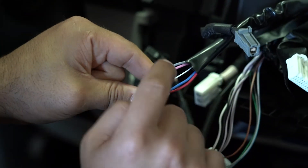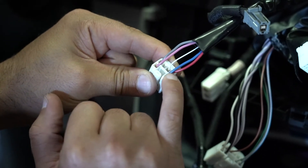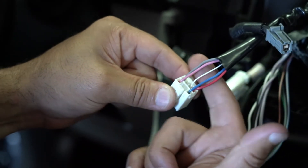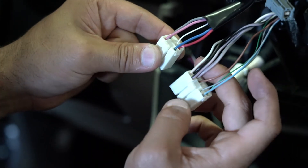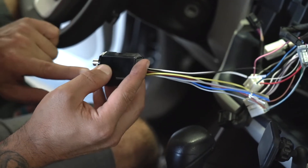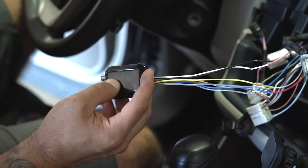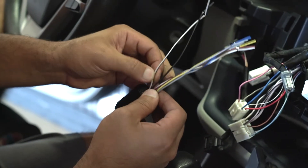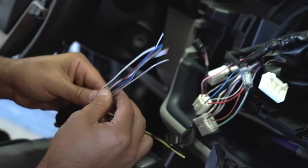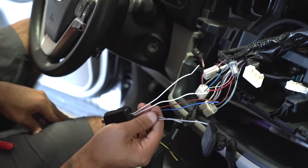So you're going to use those two wires for power and ground on the 10-pin plug. On the 6-pin plug, you're going to grab audio signal for left and right — the top two on the clip side. Blue is positive, red is negative, pink is positive, and gray is negative — so the tops are positive and the bottoms are negative. That's pretty straightforward and that's what we're going to tie in for our line output converter. This takes the high-level signal and converts it to low level — this is the RCA out that you'll run to the input of the amplifier included in our kit. You're going to connect power and ground to this harness, and your speaker audio signal for left and right to this one. What I like to do is a military splice.